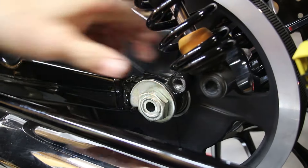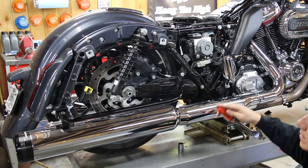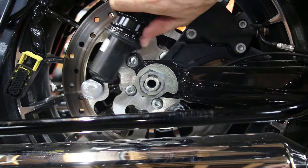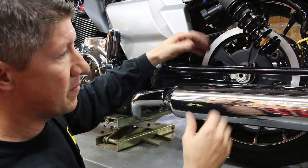Do that on both sides. Now I can use my jack to raise and lower the bike and the wheel stays on the ground with no pressure on it from the bike. So I can move this swing arm up and pull my axle out up here and it's not in the way. I can line my caliper up when I put it back in. It just makes it super easy to get that wheel fit in there.